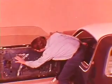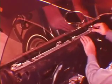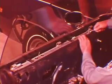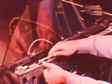For in and out adjustment, loosen the nuts on the lower tube guide. Move the belt line trim support bracket inboard or outboard so that the plastic liners engage the upstop hooks on the plate and channel assembly. Push the glass outboard until it contacts the lower lip of the outer belt line weather strip. When it does, move the stabilizers in until they contact the glass and tighten the screws. Move the glass in or out and retighten the nuts on the guide retainer.